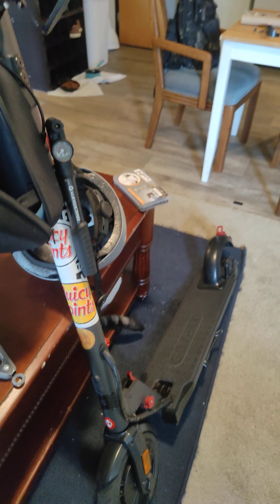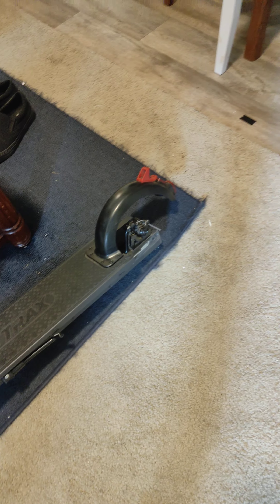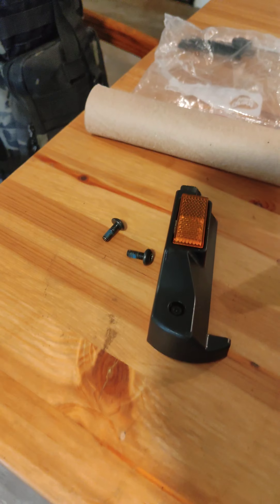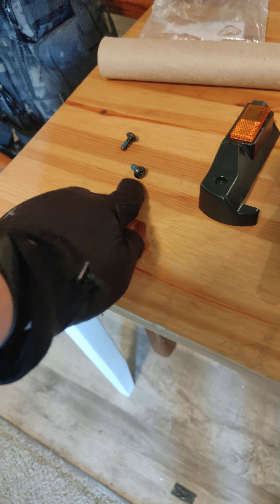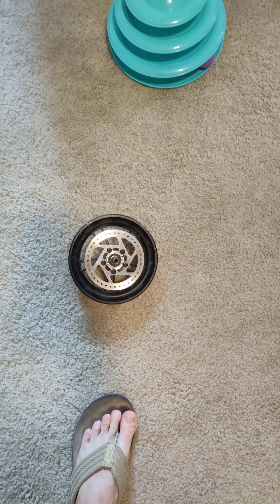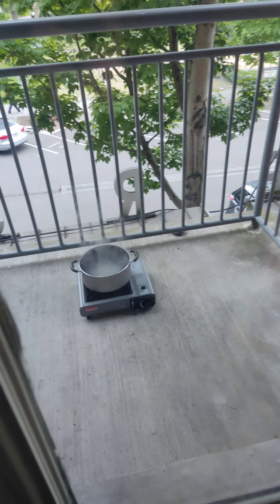We are changing our e-scooter tire to a solid tire. This is my elite scooter. There's a bolt inside — a little allen wrench bolt — to get these off, and then another allen wrench which is a little bigger one to get the tire off. It slides right off; the tube comes off just like a bike tire. It's a little rough at first but once you get like a quarter of it off, it just falls right off.